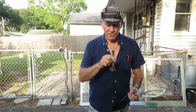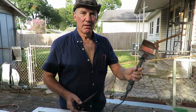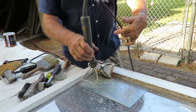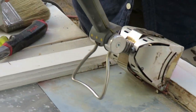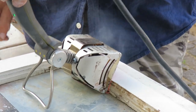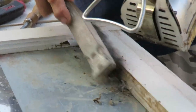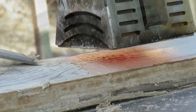There is a better way and I'm about to show you. Let me introduce you to a Swedish-made implement called a Cobra. This does have a switch — it's an infrared heating element. This thing gets so hot I could light my pipe with it. I'm going to lay this in here; I don't want to overheat the glass. I'll take a wire brush and just hover over it for 10 seconds or so.